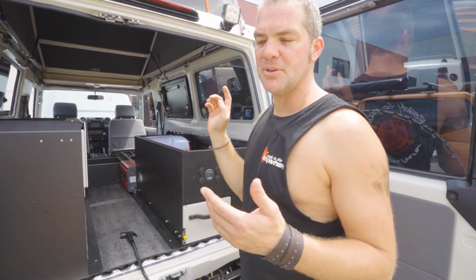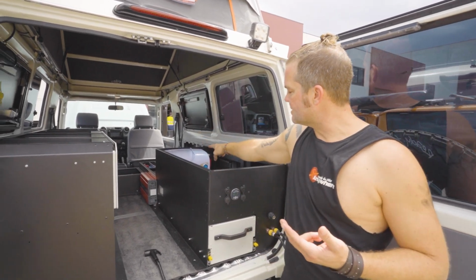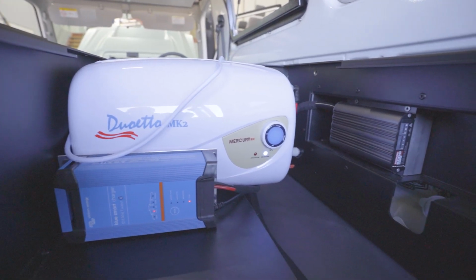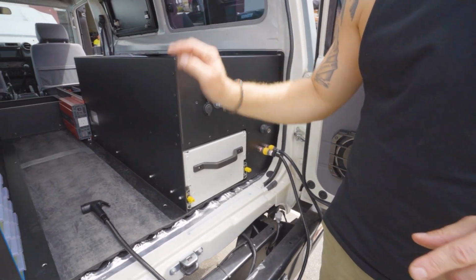And you can still get water out of the shower circuit, because you do not need to use your drinking water for showering or for washing dishes. That outlet also runs through the water heater. So it means you can get hot water out of there. You cannot get hot water out of here. Here you will only get cold water, and only from the tank.